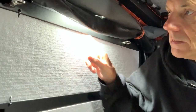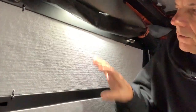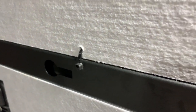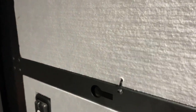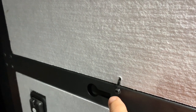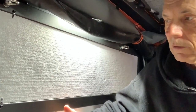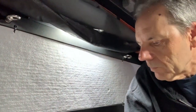The felt is fairly lightweight and easy to cut with a knife, so you can get the right shape and just insert it into the gullies in the door frame. The felt will fit into these cavities if you cut it just right. However, when driving or with a lot of vibration, the felt will fall out. You can glue it or use double-sided tape, but I prefer a more positive fastening. So I just drilled a hole on the inside edge and ran a cable tie through, which holds it firmly. That provides good insulation both in heat and in cold, and with a light-coloured felt, it also reflects light really well and gives the whole space a nice even light.